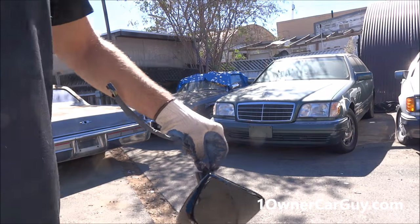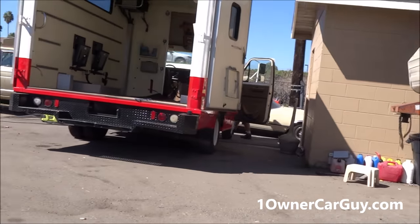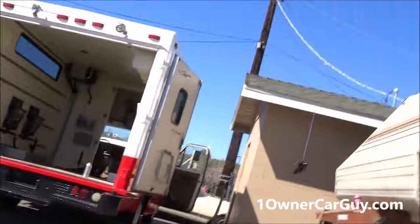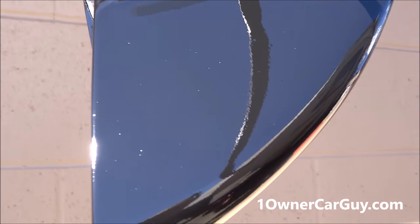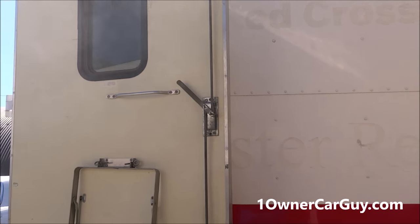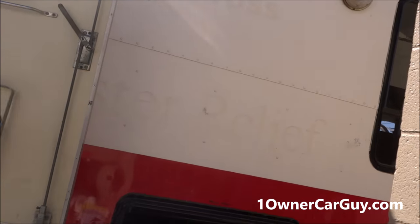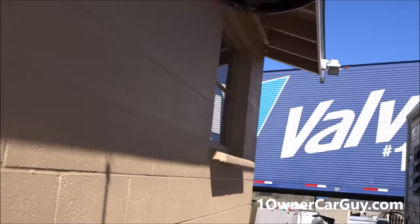Okay, from that point you should let it tack up. It's looking really nice and I don't want to touch it down, so what I'm going to do is leave this here and go hang it up. Once you've got it hung up you're going to be able to see any final touch ups you need. It looks pretty good hanging there. I can see exactly where the dust that I don't like is — it's on the underneath part there. It has tacked up just enough. I can tell by when I start spraying it on there — that is the perfect time. Just come over that with another coat and it's going to lay right on there beautifully.